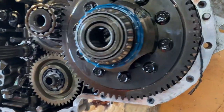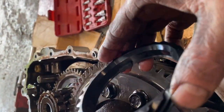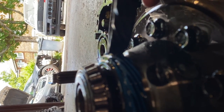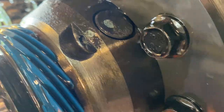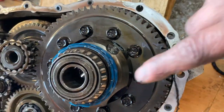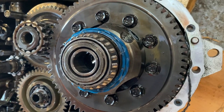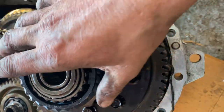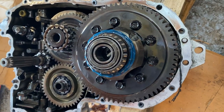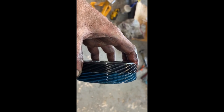The gearbox is split and this is the speedo drive ring we're talking about on the diff. If you look, they're very very close together teeth — this one is off an F20, and you can see it's a lot more coarse compared to the F28 ring. That's what adjusts your speedo, because if you keep the F28 ring on, in Corsas, Novas, and all the conversions, it reads about 20 miles an hour out. So you need to put the F20 ring on and that sorts your speedo out. The blue one is F28, the black one is F20.